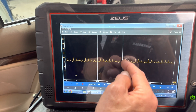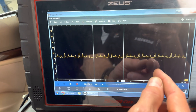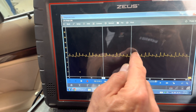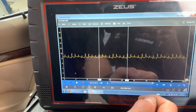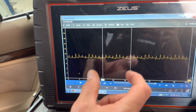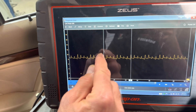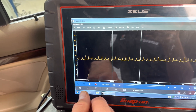We've got that hump we can pick out that's kind of different — it's tall. If we want to go to that little pointy one, we can do that too. Go one through eight and there we are, same one again. When you're looking at waveforms on fuel pumps, you want to pick a hump that is kind of a standout — there'll always be one that's a little bit different. You can measure from that, measure the milliseconds, and figure out fuel pump speed.